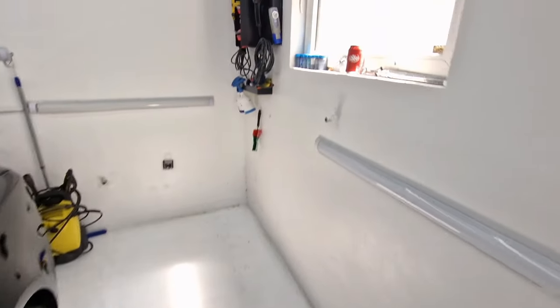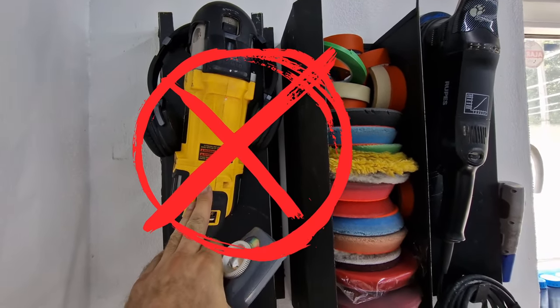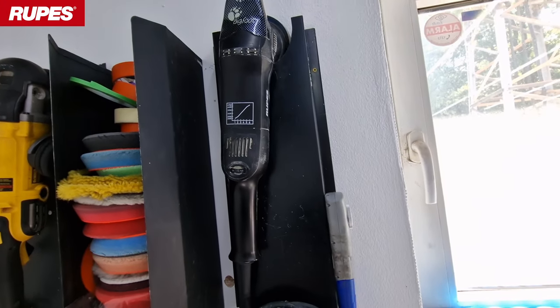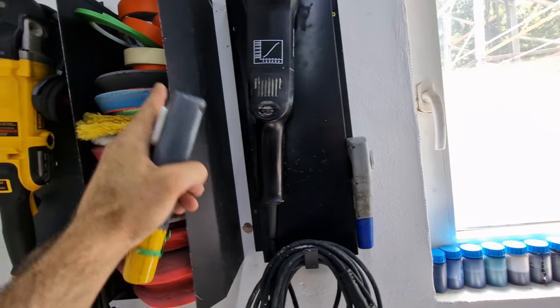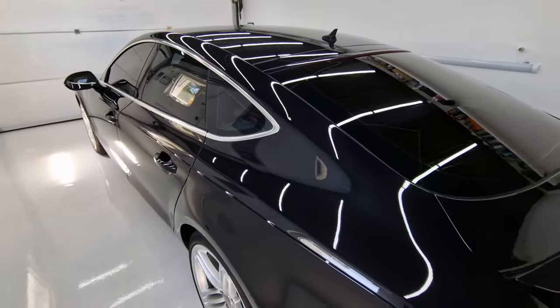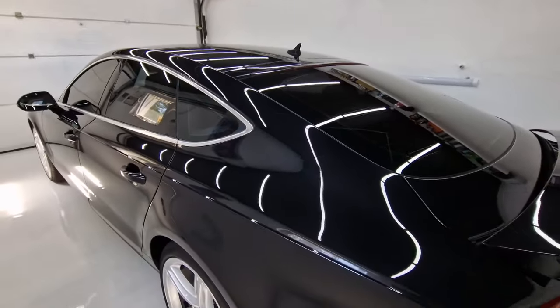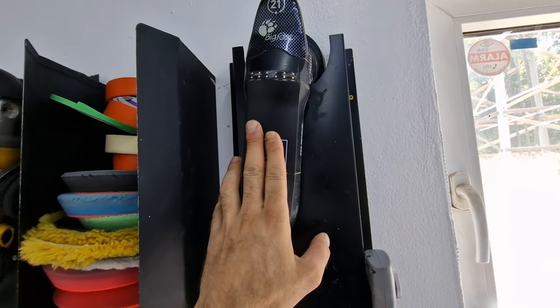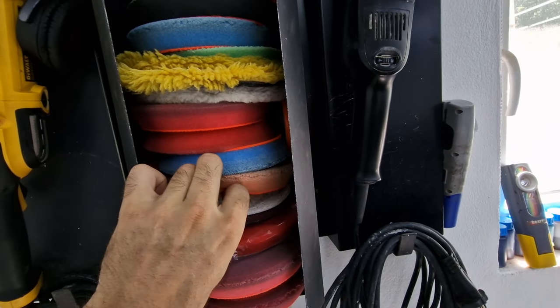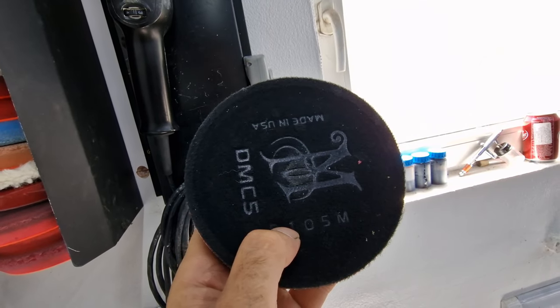Let's start with choosing the polisher itself. For one-step polishing, do not use the circular polisher — that's not the one you want. You want to use the double action polisher, as seen here. With the double action polisher and the right pad selection you can do a one-step polish. Since this car has a very poor clear coat condition, as you can see here, we decided to use the double action polisher with a microfiber pad — this one specifically is from Meguiar's, made in the USA.